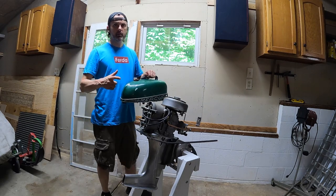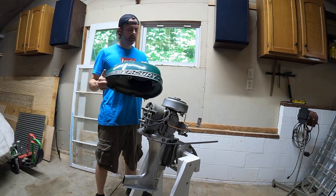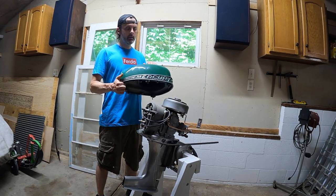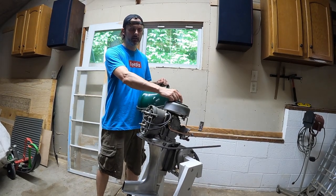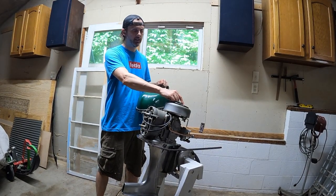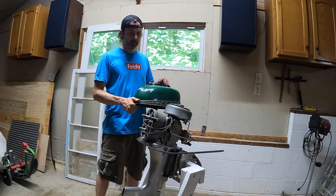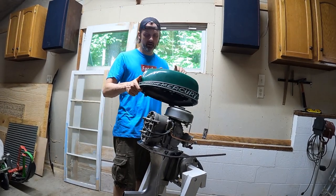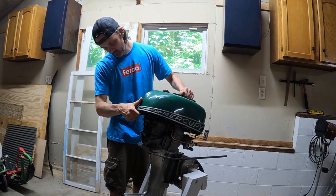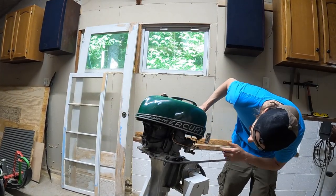So you may remember that I had an issue with the recoil on this thing — turns out I didn't. The gas tank needs to be fully seated on the engine so those pawls can engage this crank pulley nut. But if there's nothing there they'll just keep going until they lock. So that's good news — nothing was wrong the whole time, I'm just not really clear on what I'm doing.